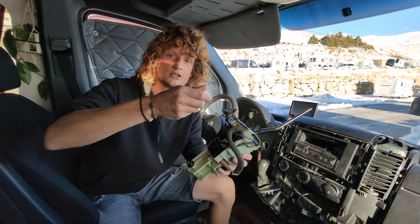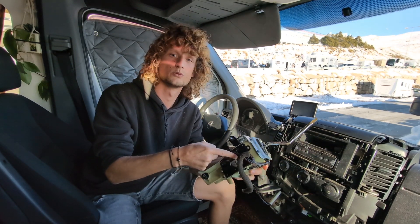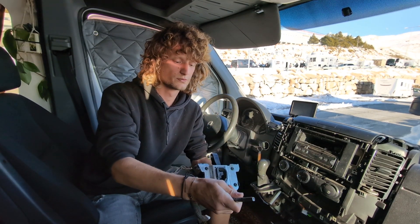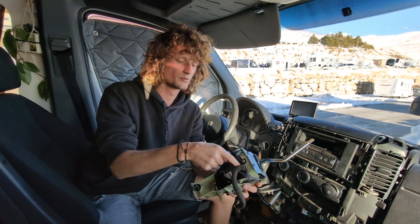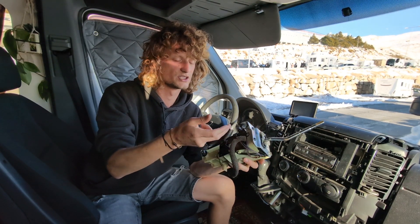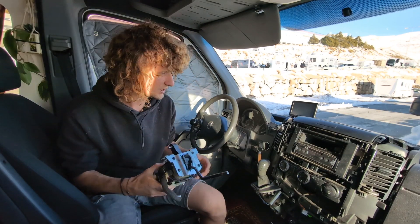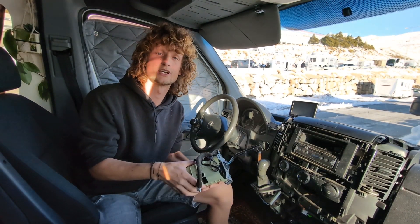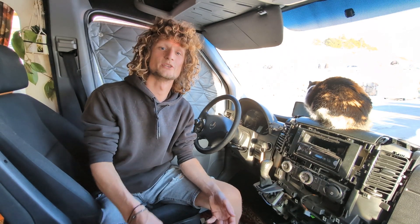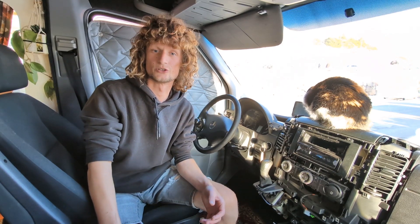When you do this, you have to be very careful. When you take the electronic part off, you will see a turning knob which turns when you select gears, so that the computer knows which gear you're in. You have to align this perfectly — if you don't and you go to shift gear, you will break the plastic part. When you do this, just pay attention. It's easy to do, but you have to do it right.